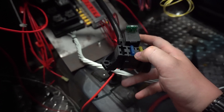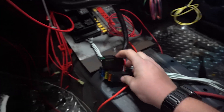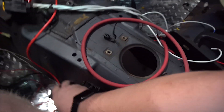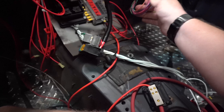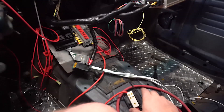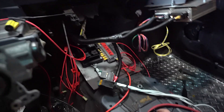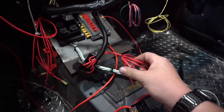So we've got this handy little fuse block right here. We're going to hook the thicker wire up to it for distribution from our battery. The fuel pump trigger relay is going to run up to what I believe is a purple wire — the fuel pump trigger. We're going to run a constant 12 volt power directly from the battery via the thick wire on the fuse block.